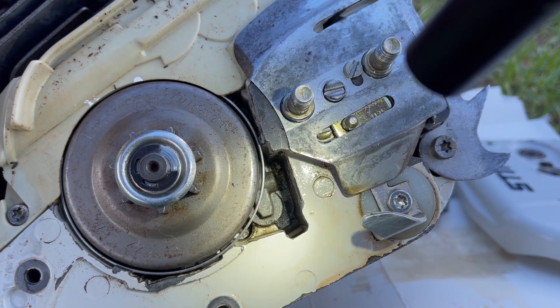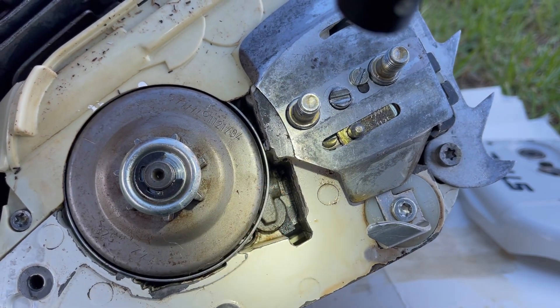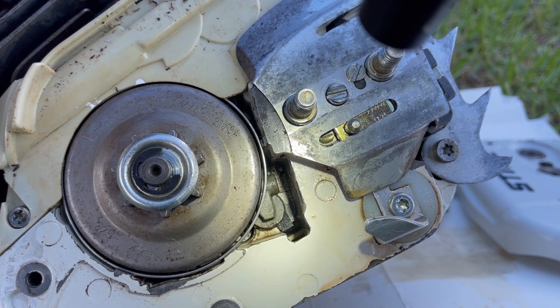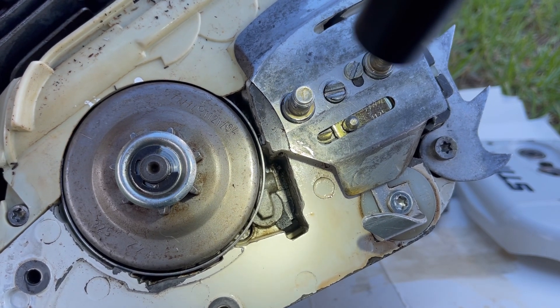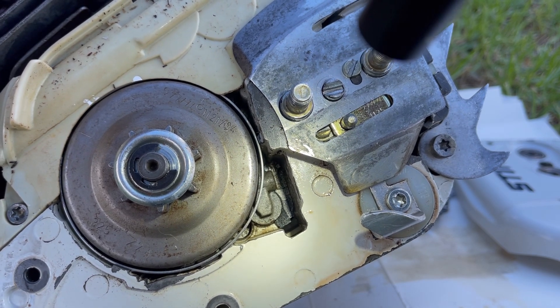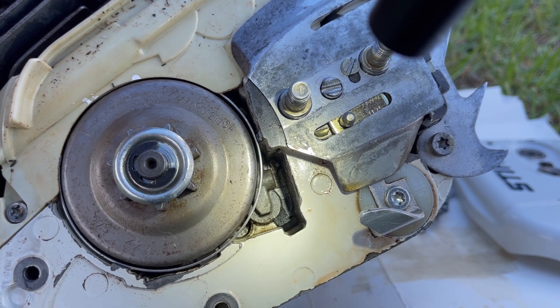If you have a look in here you can see the oil pump and you'll also be able to see the oil hose or the oil pickup hose. If the oil hose has any cracks in it then that can leak, and if the joint between the oil pump and the hose is loose then that can cause a leak too. Pop your clutch drum off, pull your oil pump off and double check that there's a nice tight connection between the two and that the oil hose isn't damaged, cracked, or embrittled.